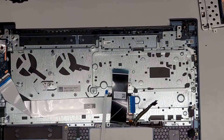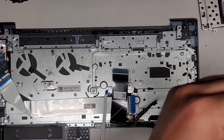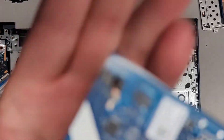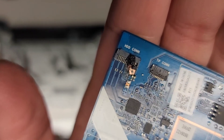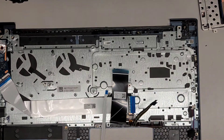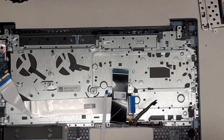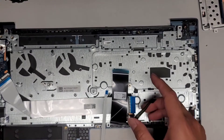I'm back — I blew out the keyboard and cleaned up this connector. It's better but I don't know — it's melted, so if it's completely melted together and those two pins are just melted like that together, that's not going to be good and it's probably not going to want to turn on. But we'll see. Usually when it burns it kind of burns till it separates. Anyways, let's go ahead and get this all back together.